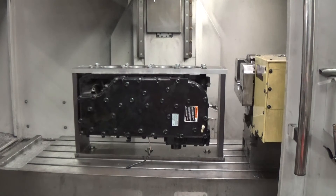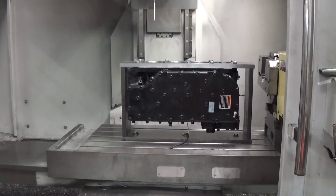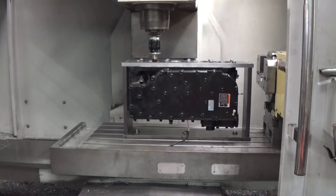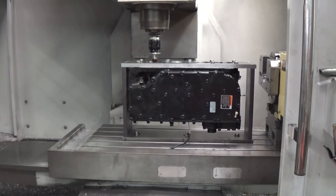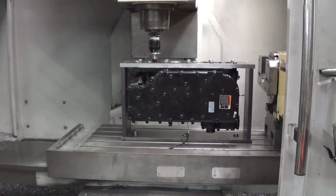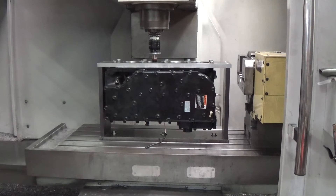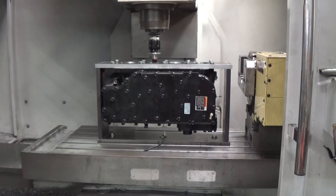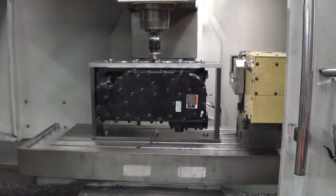So I'm just going to show you. I've got this set up. I'm just going to probe the cylinders — I've got a probe that goes down in there. It'll find the center of each cylinder, which will then allow me to bore to the minimum oversize that we can. This block will actually clean up at 15 — it's not too bad. But this is the first step, just to demonstrate this fixture and what proper fixturing will do for the accuracy of the job.